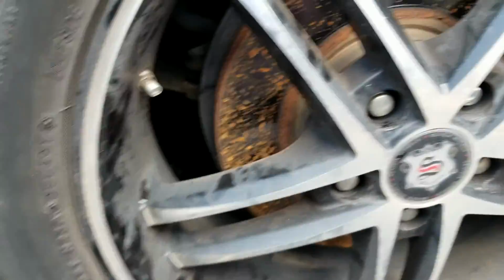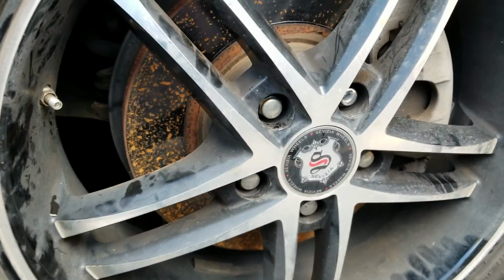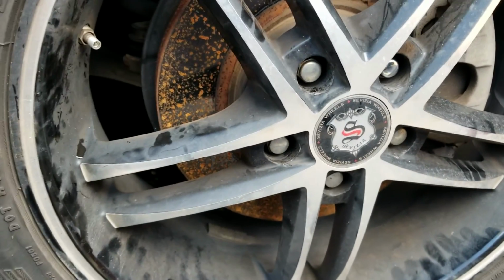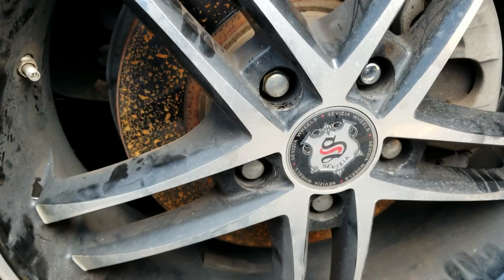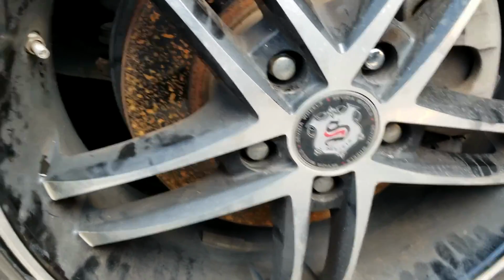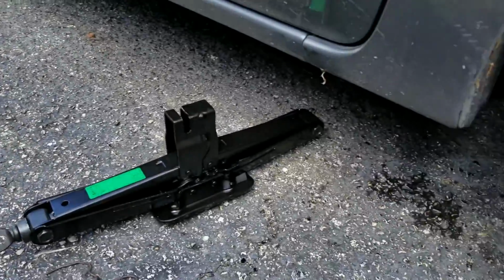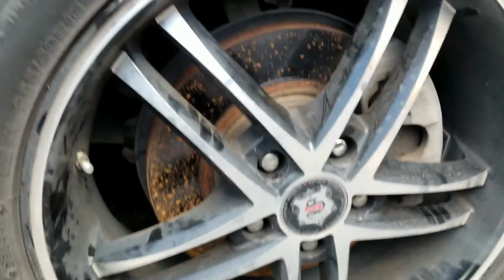After patching up the tire, I put the tire in the rim on the, I don't know, brake, whatever that's called. Then I put the lug nuts in, tightening them, but not too tight, just enough to hold the rim in place. Then I lifted the car to remove the jack stand, then lowered it just a little bit to the point where the car is sitting on the tire but not putting its weight on it.